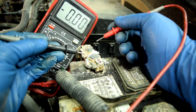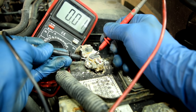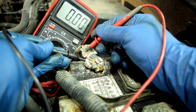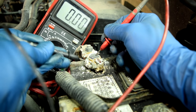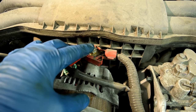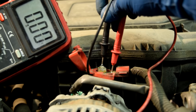We're going to start our voltage drop test at the most likely culprit, which is the corroded terminal. Put one test lead on the post itself and the other on the terminal. Whatever number you see on your multimeter is the amount of voltage you're losing from that terminal to the positive post of the battery. As you can see, we got about 0.01 to 0.02 volts depending on placement, which is really nothing. The next place to check is from the stud to the cable itself — again, one test lead on the stud and the other on the cable. There isn't any voltage loss on this car.